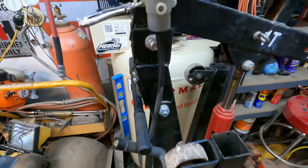So before we can connect our pressure line to our slave cylinder down there, we should top off this reservoir all the way to the top. And once we connect that to the slave cylinder, we're gonna air bleed it, or gravity bleed it. And the guys online said to let like a whole cup come through it, like a whole reservoir full. It seems like an awful lot, but we'll see what happens. So there it is. We're full to the tip top.